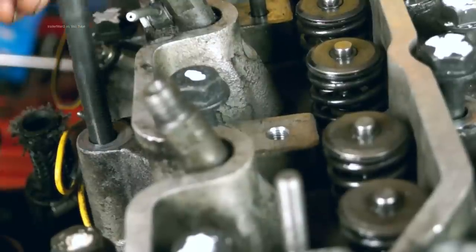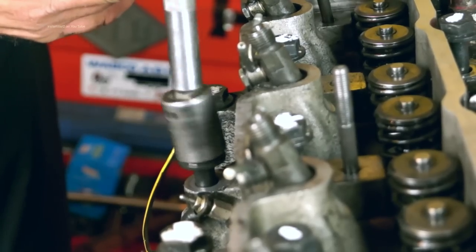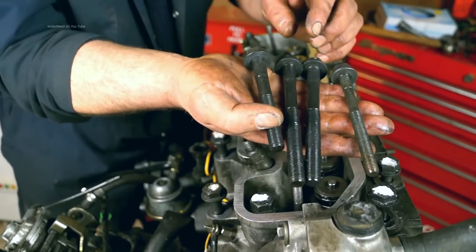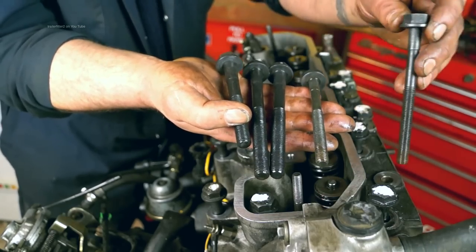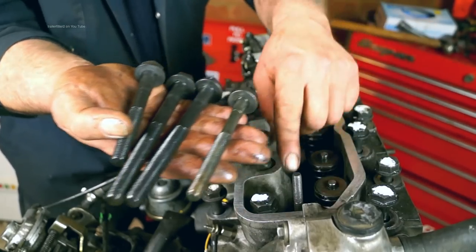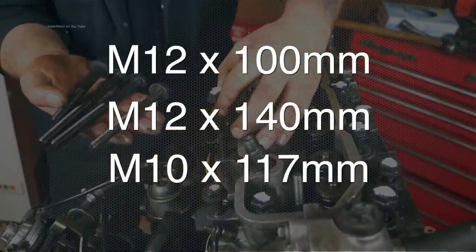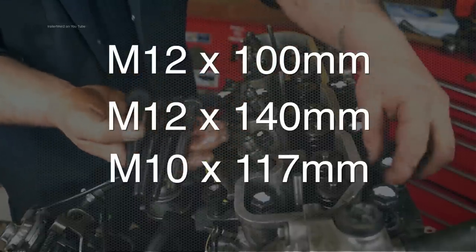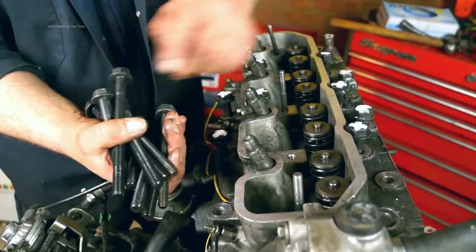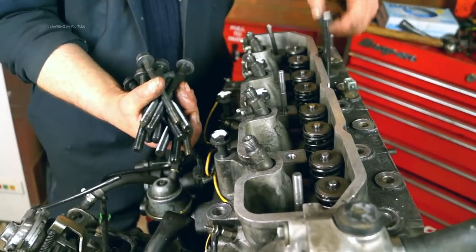On this side of the engine, where the injectors and glow plugs are, this is the shortest bolt. You have the short M12, the M12x140, and then the M10x117mm. They should stay in order and go back in the right places — you can't really get these wrong. The sizes are shown on screen and in the manual. Look after your bolts, make sure the threads are alright. You don't want them too oily or damaged, otherwise this could hinder screwing them back in. Any doubts, chuck them away and get new ones.